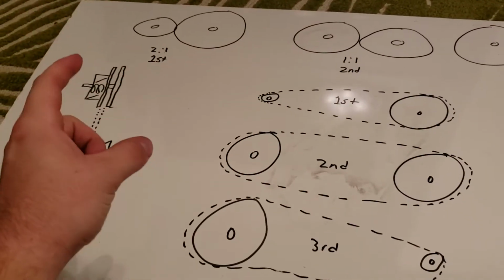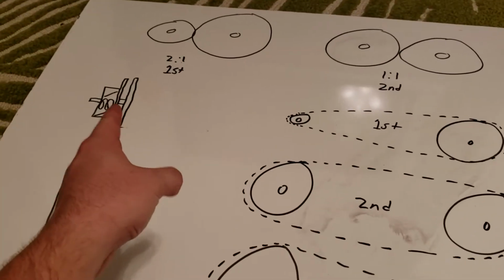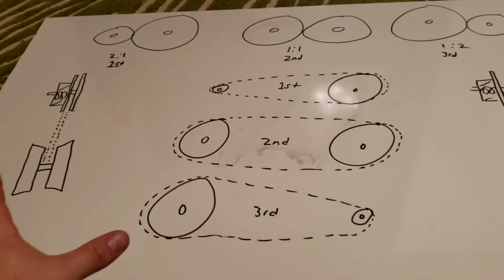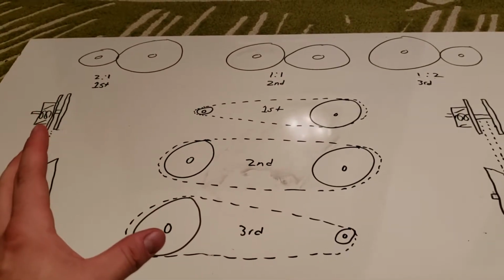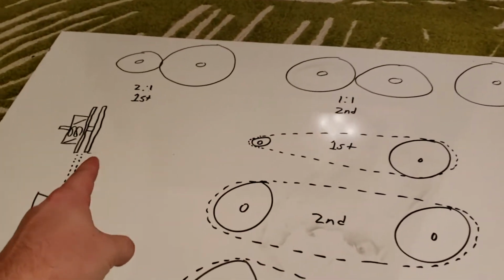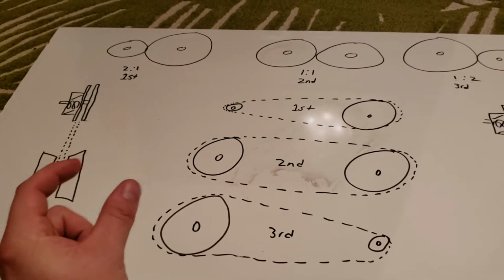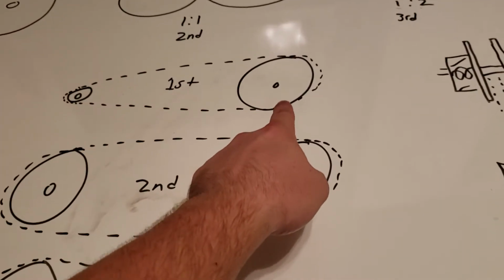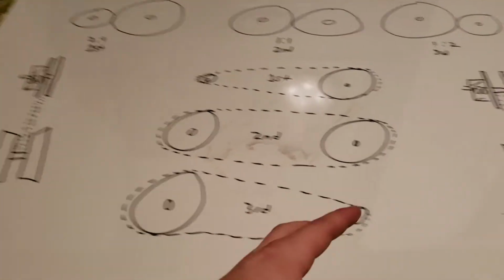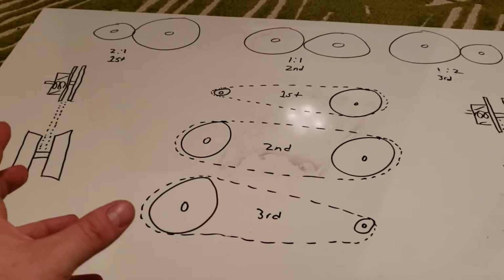And what people have found, when you put on bigger tires and you go to accelerate, is that the factory spring is very quick to expand, which is not what you want when accelerating at the beginning, or if you are cruising along and then you find yourself going up a hill. You want this rear pulley to contract sooner so that it goes back to being bigger rather than smaller, giving the front pulley, the engine, the advantage. So I know this is a little hard to grasp. I'm trying to explain it the best I can.